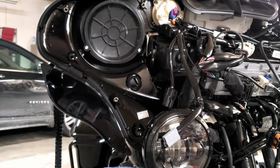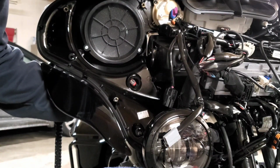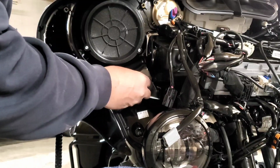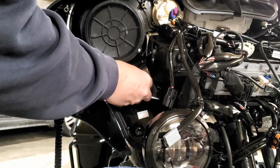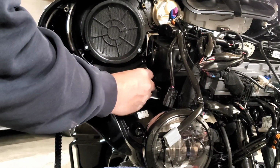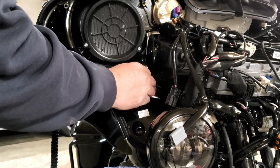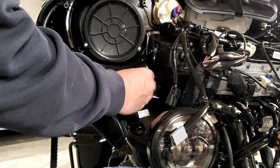Okay, so pop our little button in from the front. Put our washer on the back. Grab your nut. Make sure you use a 3/4 inch deep well, because you gotta get up in there around the plug-in part of the switch here.